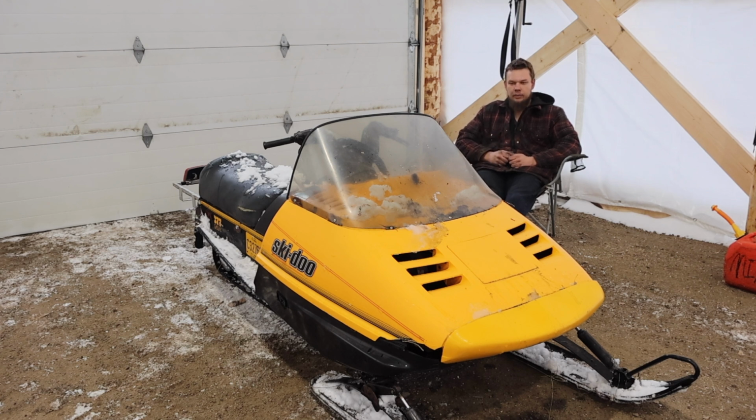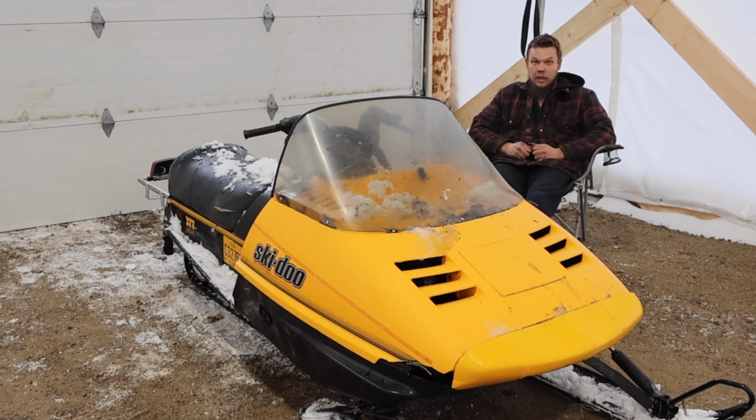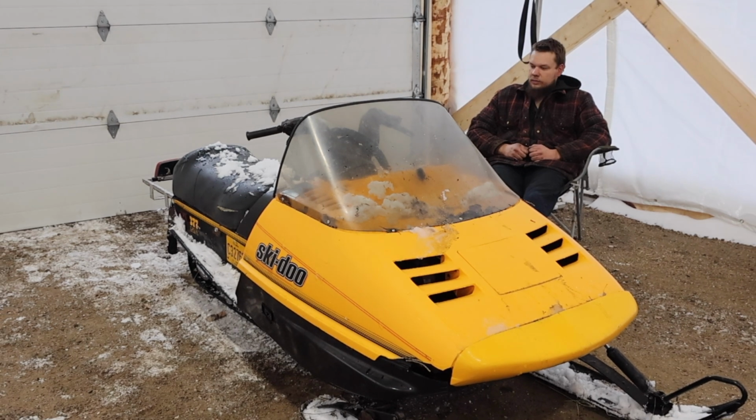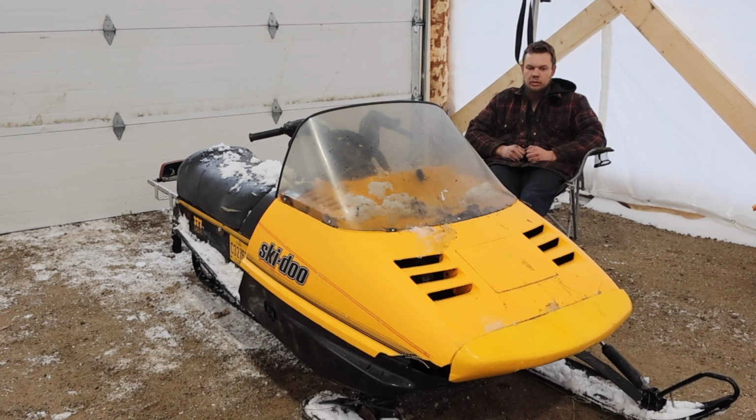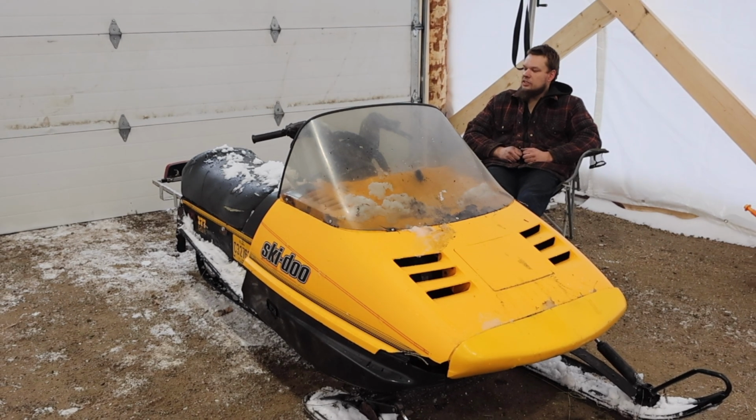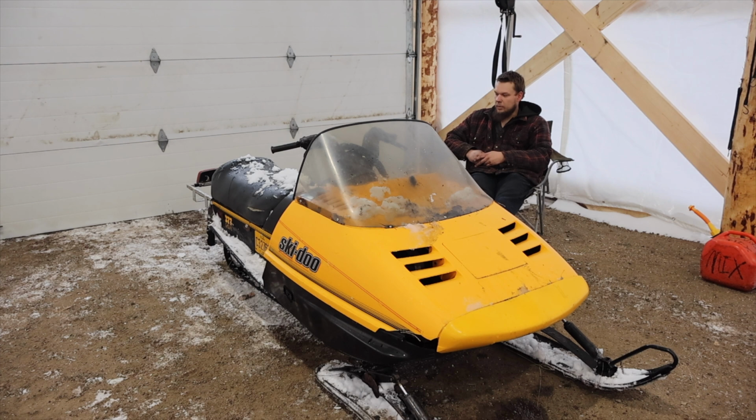Under the hood, we have a clutch problem, a major clutch problem. In the secondary clutch, or the driven clutch, we have a slider that is missing. On the engine side of things, we have 2 bad motor mounts. So I think what I'm gonna do is order parts for this, and in the next video you'll see me repair it. I'm just gonna leave this as a diagnostics video. Tune in next time on this guy to see how the repairs go.